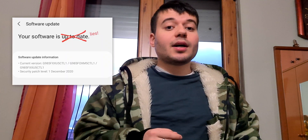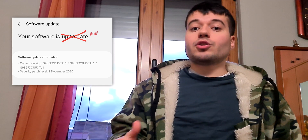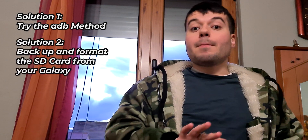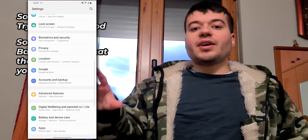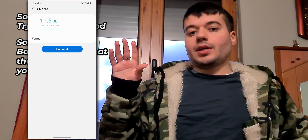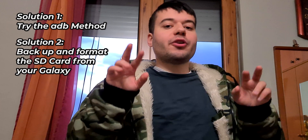Congratulations! Now, keep in mind you will not get automatic updates until the stable update is installed, so you'll need to repeat this process for every beta release. Some people may get an error updating via SD card — it could be the update file itself, in which case try the ADB method. It could also be that your SD card is incorrectly formatted. Back up your SD card data, then go to Device Care > Storage, tap the three dots, Advanced, select your SD card, and format it.